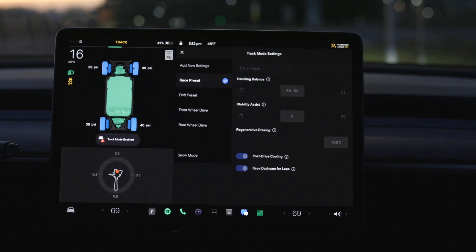I cannot stress how important this update is for snow driving — being able to turn regenerative braking all the way off so you can control when the car brakes. You won't come up to an icy patch, take your foot off the pedal, and have the car potentially drift. Now you have full control of braking in tricky situations. I hope you liked this video. This has been Nick with Adventures with Nick — please hit the like and subscribe button and I'll see you next time.